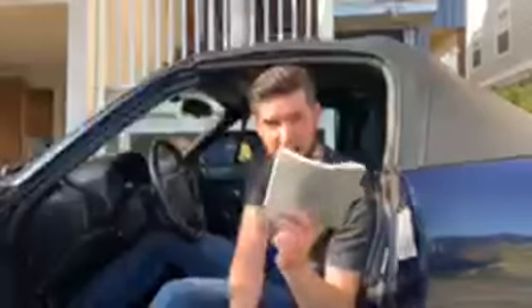There are some important things in the owner's manual to review before you start. It's going to tell you where the equipment is located and give you safety tips. The other super important thing you'll learn is where it's safe to jack up your car. There are a lot of things underneath the car that look like reasonable flat points, but generally there are only a handful of reinforced points. In fact, on this car, someone previously jacked it using the wrong points and actually bent and deformed one of the frame rails.